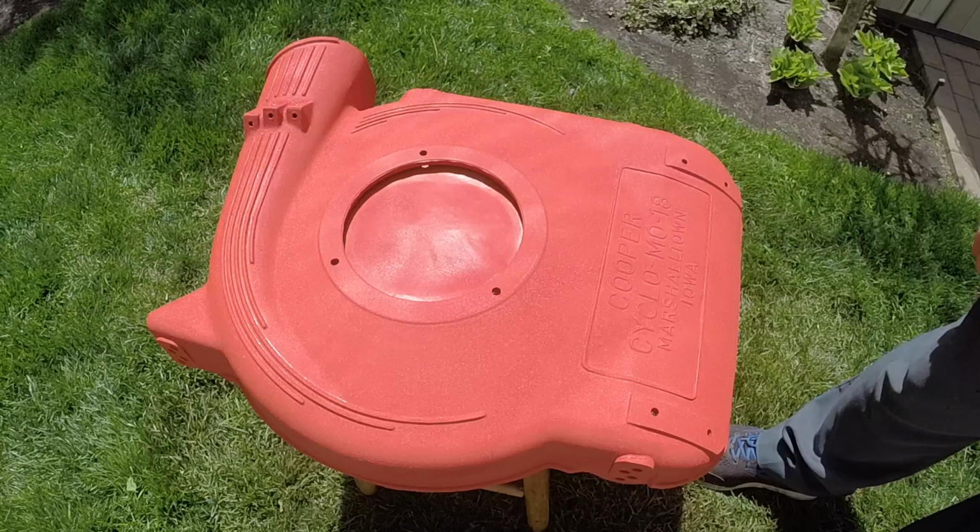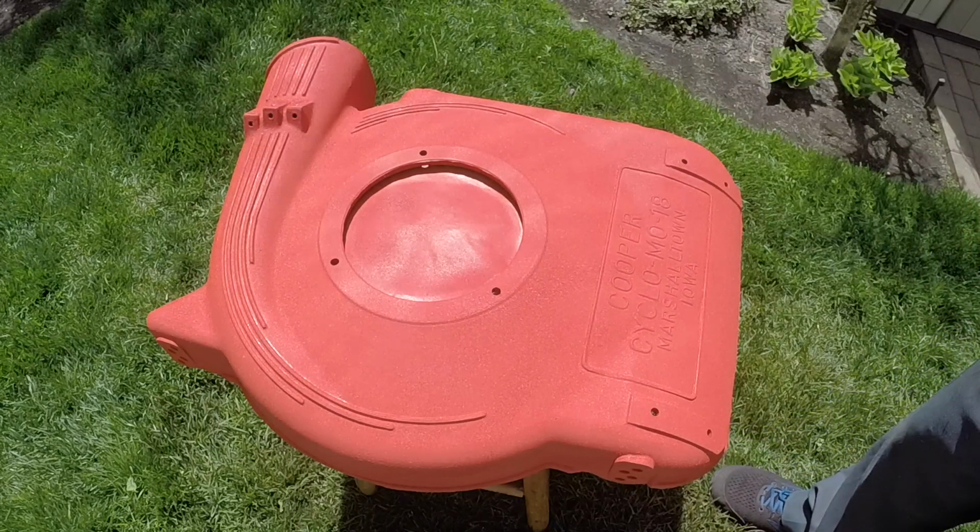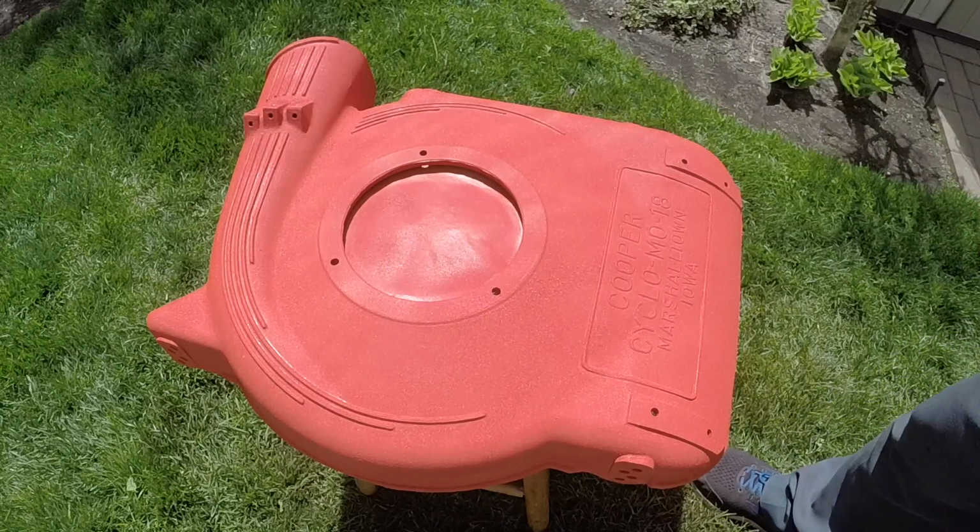In the meantime, I can get the handles apart and the engine off the other mower and get everything ready to paint up with acrylic enamel on the engines and get the other deck painted. Well, that's it for the mower video. I'm just kind of putting up videos as I do. A lot of you wanted to see the restoration of that old mower, so the deck is in red right now, and in the next few days I'll fix the oil leak on the original Briggs and Stratton 6BHS for that deck. It needs a new crankcase gasket between the crankcase and the base.